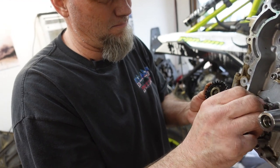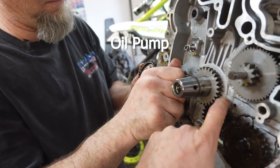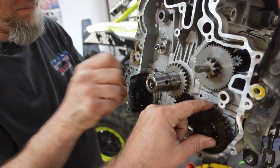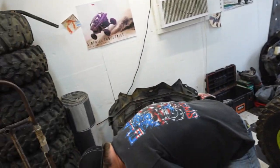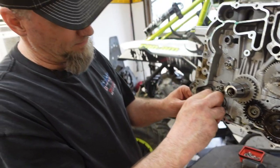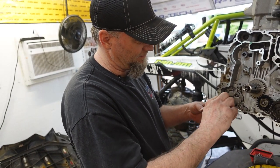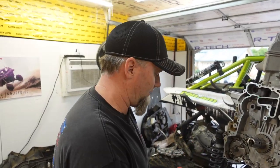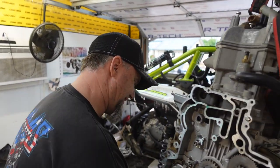You can see that gear is still good — it was still driving that water pump. This gear is still relatively good, it was driving this water pump even though the water pump gear probably had about 10 more minutes of run time left before it would have been absolutely done. Then you would have had some oil pressure issues, I'd assume.